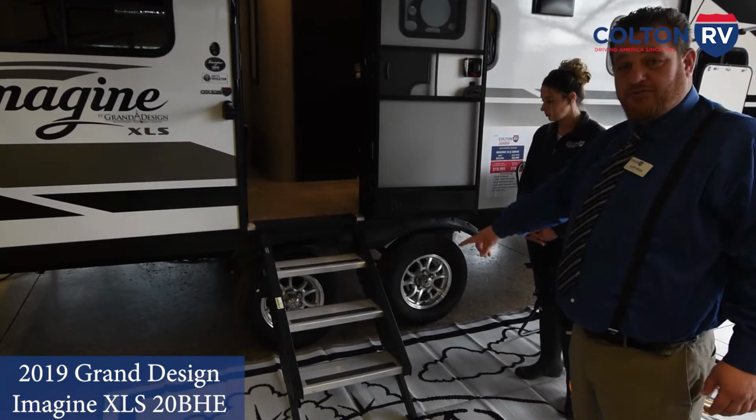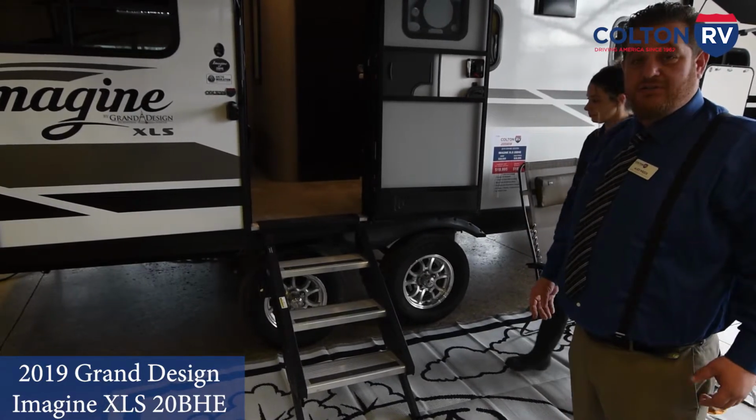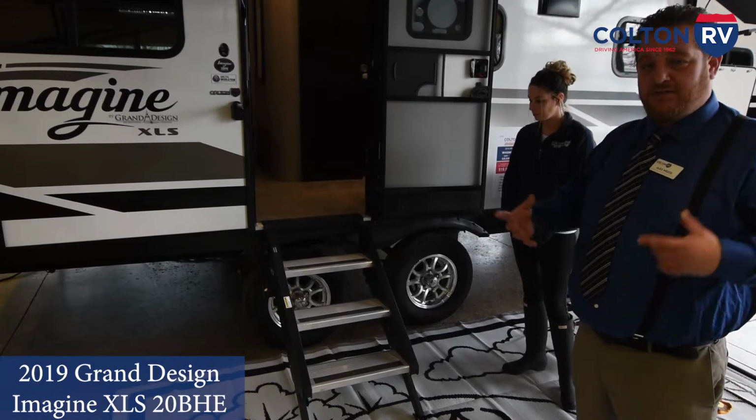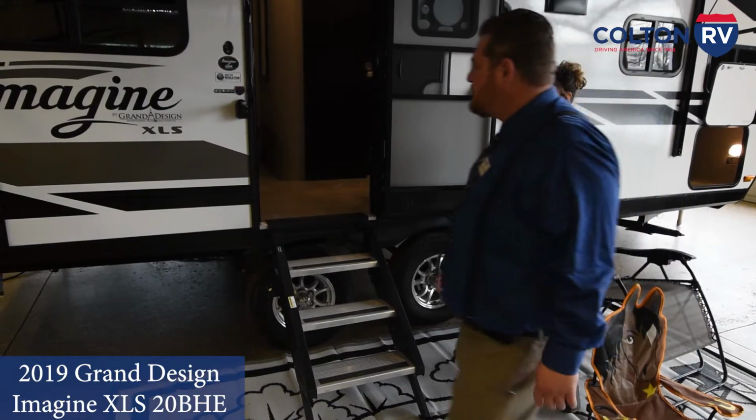We do have dual axle, 14-inch aluminum wheels filled with nitrogen. The benefit of nitrogen is it won't expand like air. It won't expand and contract. So as you're going on the road, things heat up, the air inside heats up. It's not going to overpressure your tire.